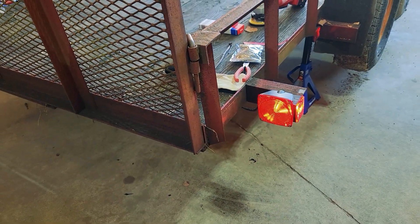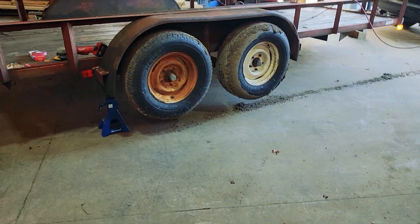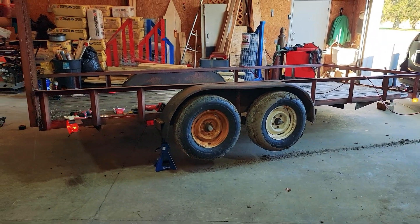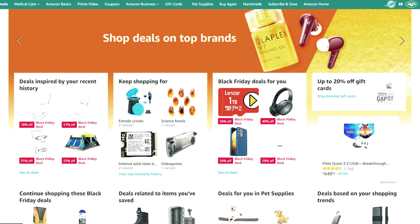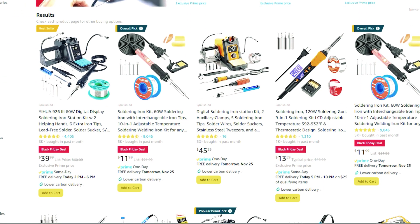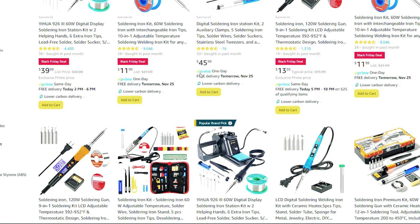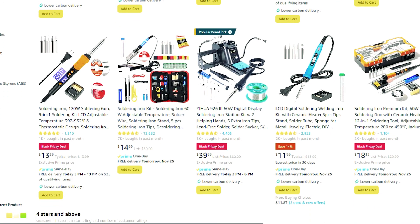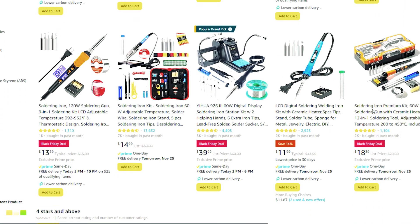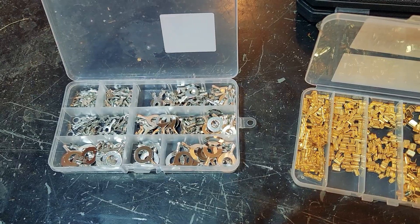When doing this work I wanted to get it right and have a lasting repair for both trailers. I've never had a good soldering iron, and when researching the best soldering iron I came across videos that strongly suggest that automotive wiring should always be crimped and not soldered. That case was compelling enough that I did not buy the soldering iron but bought crimping pliers and an assortment of connectors instead.